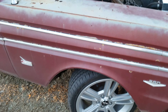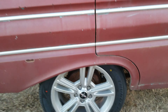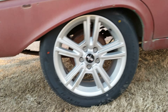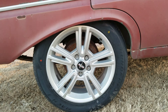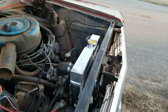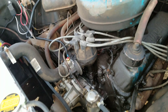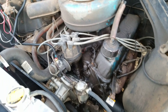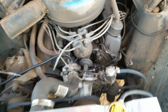The back originally had a smaller tire, but I put a taller one on there and it fits really well. I couldn't have gone much taller — this is a 26.3-inch tall tire. Part of the intent with the electric fan was also to get a little better gas mileage, because it originally had a four-bladed solid cooling fan, and that is horrific for performance. With an electric fan you don't ever have to worry about cooling as long as your radiator's full and moving fluid, but a solid fan is not the best for performance.